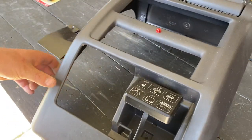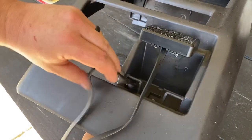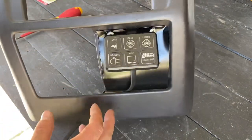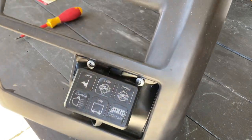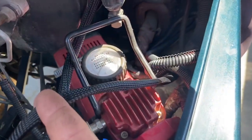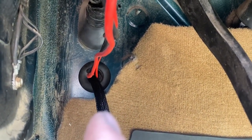I went a step further — I'm going to take our cable and put it through this hole and just kind of pull my cable through, that way the cable has somewhere to go. I took some sheet metal and shaped it to cover up the backside just to make it a little bit nicer. You don't have to do that. Now we have the switch panel secured to the Jeep, very secure. We're going to take the low control current cabling for the switch panel and feed it through the firewall — there's a grommet underneath here. You have to pull off the grommet, feed your cabling through the grommet, and then put the grommet back in. I'm just going to leave this cable right here on the floor and we'll come back to it later in the video.